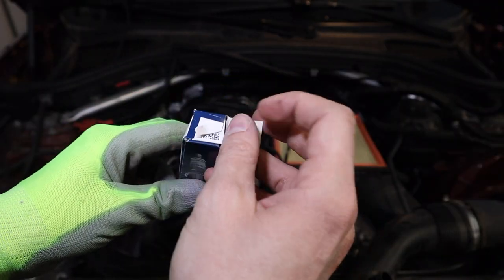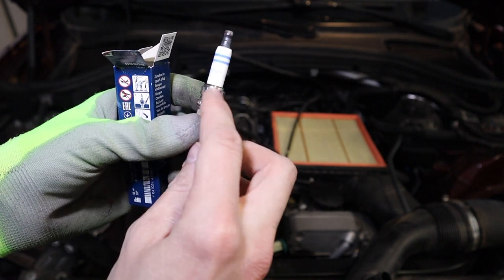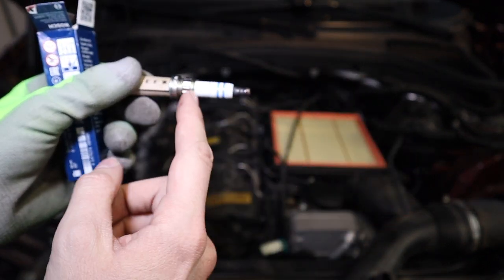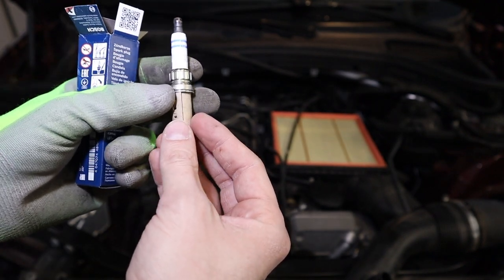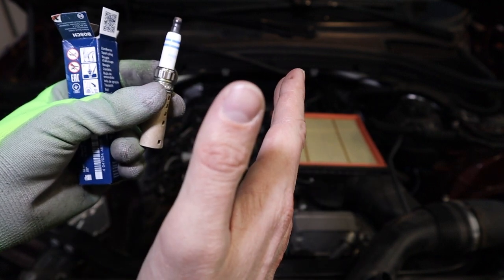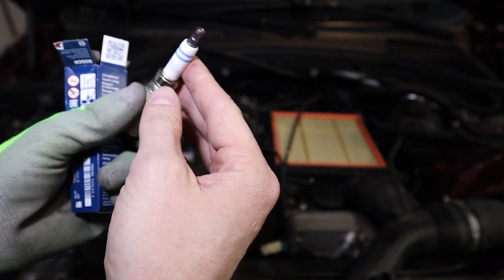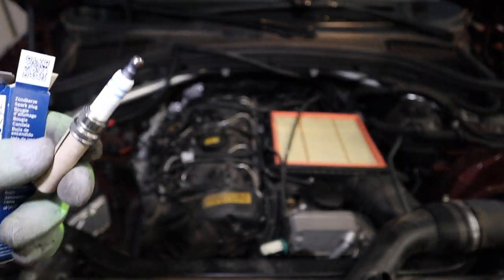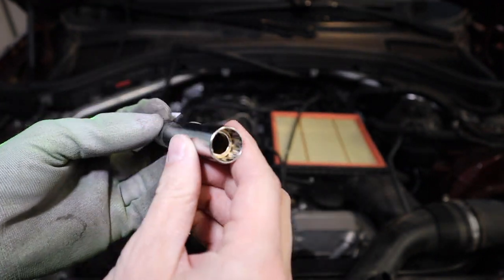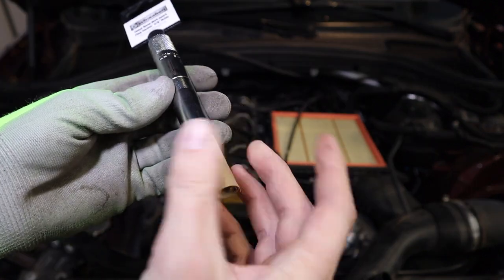Here's one of the spark plugs — it's a Bosch OEM replacement, nothing fancy, just going to swap it out directly with a new one. You can see that this actually has 12 points on it, which is different than a lot of spark plugs. It is also very narrow and low profile, and that's why we're going to need that special socket. The channel it goes into on the top of the engine is super narrow as well. If you modify a 12-point socket, by the time you get the walls small enough to fit, you could actually end up breaking it — I've seen people online break their modified spark plug sockets. Here is the Schwaben Deepwell spark plug socket, 14 millimeter, 3/8 inch drive. It does have a magnet on the end so it will hold on to the spark plug.